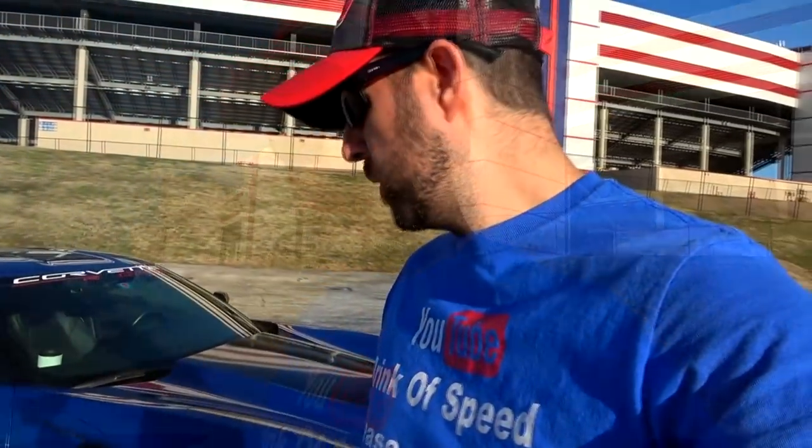The next thing to do before you go to the track is double-check your tires. Make sure you have tread life left on them. If you don't know much about tires and you have a Discount Tire near you, they are the best company as far as tires go — I'm not being paid to say this, just have a lot of experience with them. Take your car there and ask if your tires are at a safe tread depth to do a track day. That's the second thing.